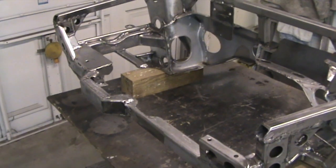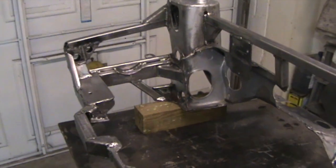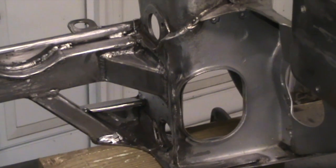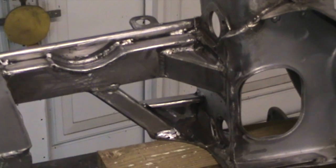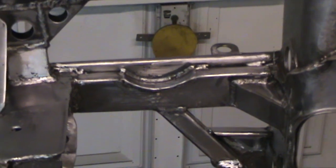I had to make a modification at the front here for the exhaust to pass through. On the driver's side I've put a couple of extra reinforcements in this corner — you can see a horizontal gusset and also one down at the bottom at 45 degrees. There's a small semi-circular cutout there, that's for the bottom poly.